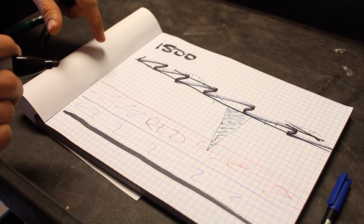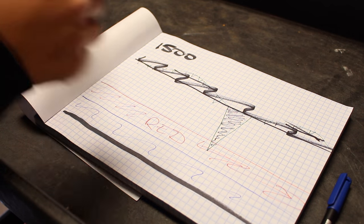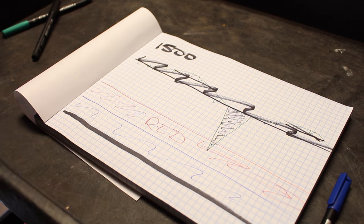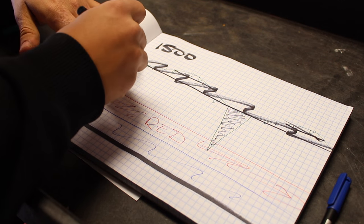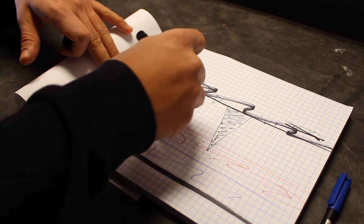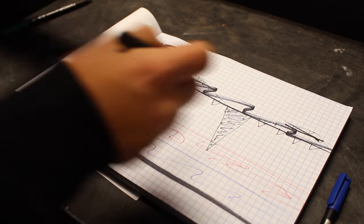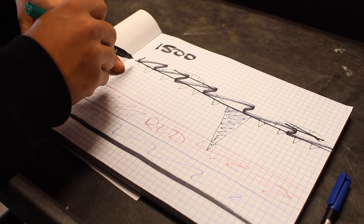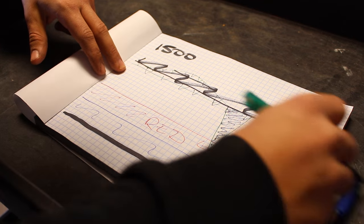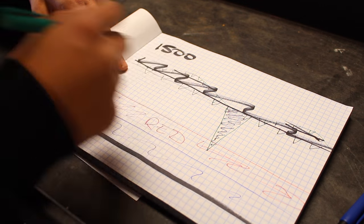And those were fairly deep. This one here, you're not going to get rid of, but again, that just depends on how deep the scratch is. Now, after that's gone, when you're sanding down and you're using a 1500 grit, you're going to be making little scratches in there, and that's going to be very uniform all across the paint. And the way you get rid of that is with 3000 grit sandpaper, and then it chops it down to there. And then you're basically working your way down to get rid of all the little scratches that you're putting in the paint.